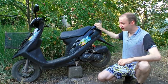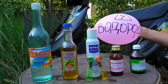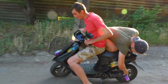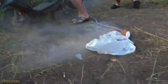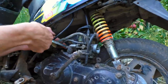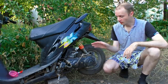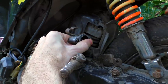I want to make this scooter run on alternative fuel. To make this real, I need to find out what kind of fuel will work best. To make this experiment fair, I've gone to the extremes - I have removed the carburetor to prevent the previous fuel mixing with the new ones in the float chamber. I'm going to deliver the new fuel directly to the engine manifold, and simultaneously I will be controlling the fuel-air mixture with my finger.